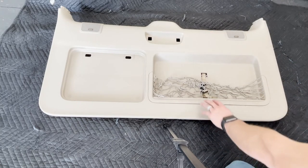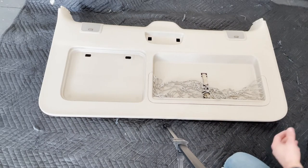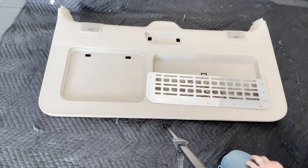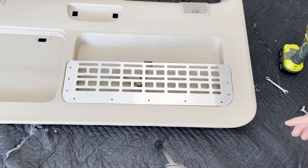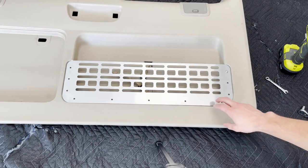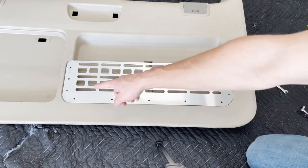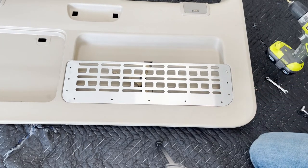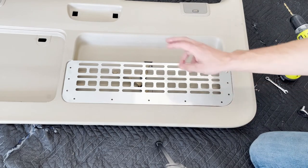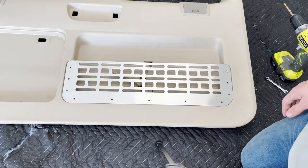Next, we're going to get the old net off — it's held on by Phillips screws on the back side. Take those screws out and then put the new molle panel on, mark the holes, drill them, and get it mounted. The net came off super easy. I went ahead and put the molle panel on. There is a front and back — mine had a protective film on the front side. The curves are a little different so make sure it's oriented correctly. Drill bit size is 13/64. I got one corner in first to confirm the size, then drilled the rest of the holes and tightened them all up.